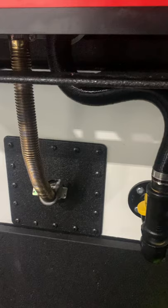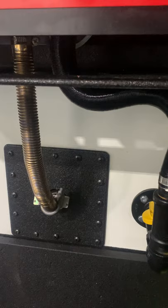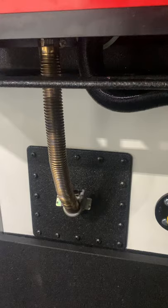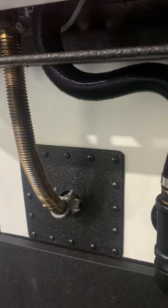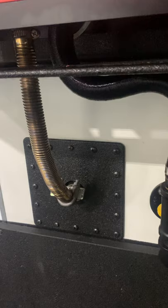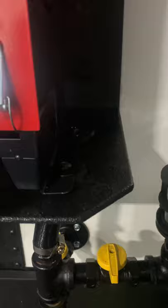As far as the exhaust goes, we took a four inch hole saw and punched it through both walls — inside and out. Took an eight inch plate, had it line-x'd, put an inch and a half hole in it big enough for the exhaust. I'm using the marine exhaust on this. Cut that pipe — if anybody knows, it's very hard to get back on a flange, but it can be done. You've got to grind a little bit of the flange off to get that pipe to fit back over, and I had to get a one inch pipe expander to open that pipe up a little once I cut it down. I used a GM catalytic u-bolt made for GM cars on catalytic exhaust — it works perfect, doesn't leak at all. Also rubber washered it down on the shelf just to help with vibration a little bit.